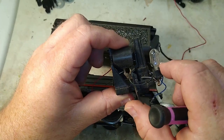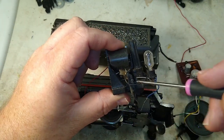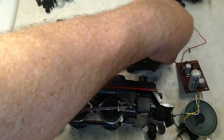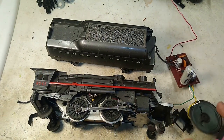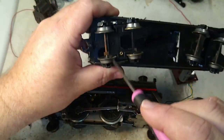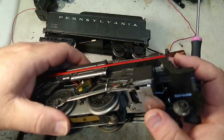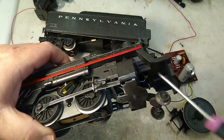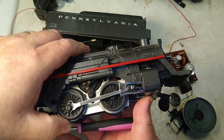These two little brass contacts — as the side rod goes forward, the contacts come together and feed power back through the wire, through the tender connection, and provide a hot signal for this circuit board, which then drives the speaker and then out through the common goes out through the wheels. Every time the side rod goes forward, it completes that connection and you hear a chug. When it goes back, the connection is broken and it's silent.